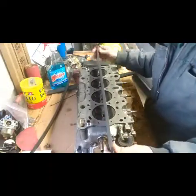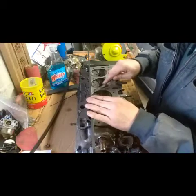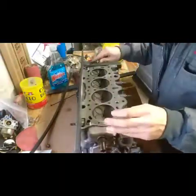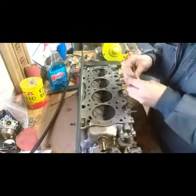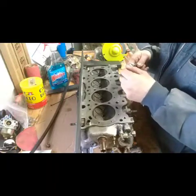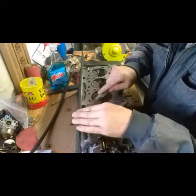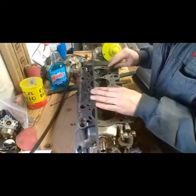Test it there — nothing. That's two thousandths of an inch. The smallest I have is a hair under a thousandth of an inch, so we'll test that with the small one. So far we're good — looks like I could build this head.